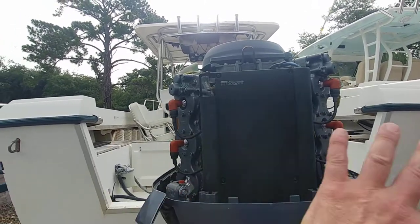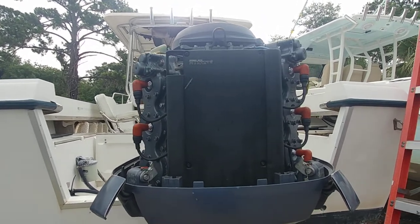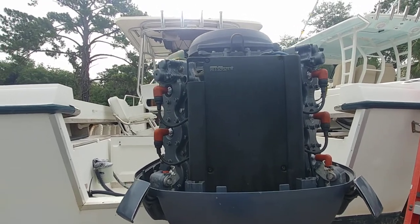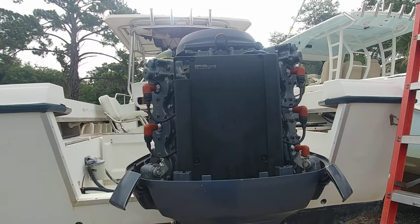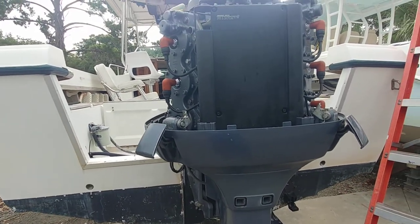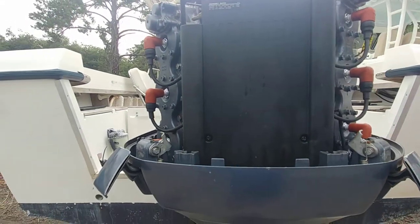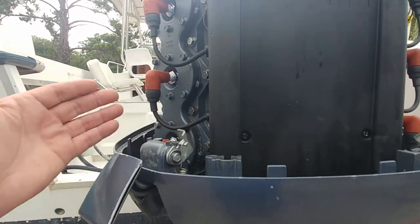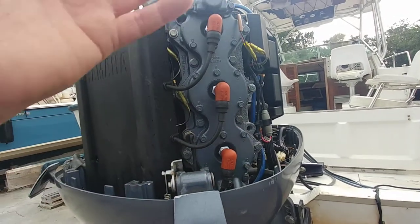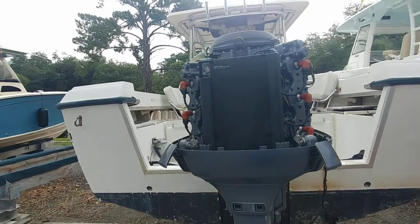And I think a little Yama-Lube, and blowing some of this carbon out, things will line up a little better. But I don't have any complaints. According to Yamaha specs, you want to be within 10 to 15% from high to low, but you're consistent on your individual sides and your compression is good. I've run into these engines where the top I usually get is 125. So I'll have like 125 to 130 on one side and then 85 to 95 on the other side. So I'm not going to complain if I'm running compression 130 to 150.